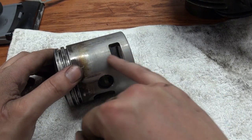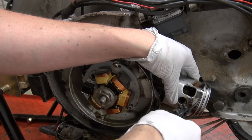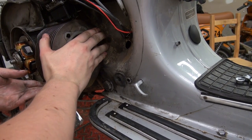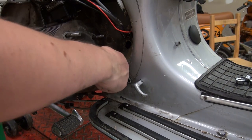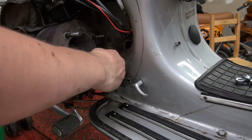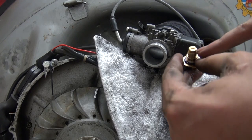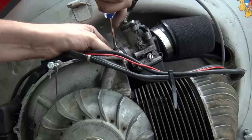I cleaned everything up, opened the ports on the piston a little bit, and fitted the old piston rings as I didn't have new ones and I wanted to ride. At this point I was about 4 hours into the project with about 90 minutes before having to ride 60 miles, so I was scrambling. Because the cylinder studs were such a pain to get out, I went ahead and recut the threads as I usually do — it makes re-threading so much easier, and next time you can literally pull them out by hand. After torquing down the cylinder and flywheel, I took a quick 5 minutes to re-jet the carb, dropping it by about 4 points and raising the needle, which was a bit too lean at half throttle.